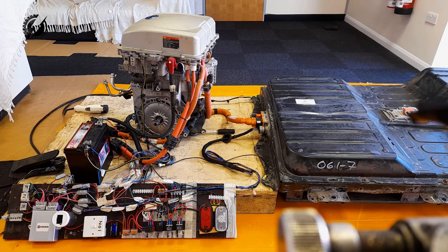Good morning ladies and gentlemen, you're looking at an early stage of an electric vehicle conversion. I've got the major components removed from a Nissan Leaf, which fundamentally comprises the motor — which has an integrated inverter, charger and charging connections — alongside the 12-volt and traction batteries. In the foreground I've got a temporary board which has been used to mount up the electronic control unit and its small display unit. It also has four switches, four relays and a couple of lights to simulate the car's braking and reversing light systems.